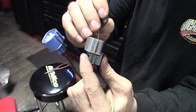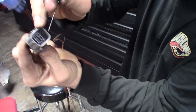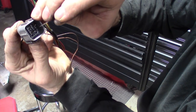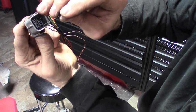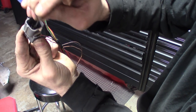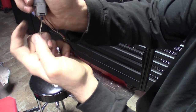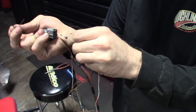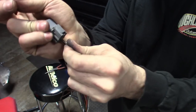I use these T-pins to back probe wires as well. Let me get a close-up shot — you can see that's the locking tab right there that the white thing locks into. Just shove it down in there, apply pressure, and it pops right out. And you didn't even destroy the pin — you can pop it right back in there if you wanted to and it'll lock right back in.